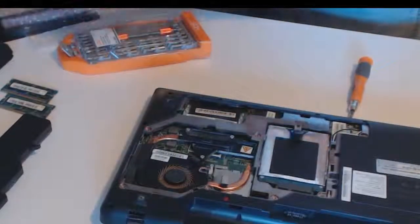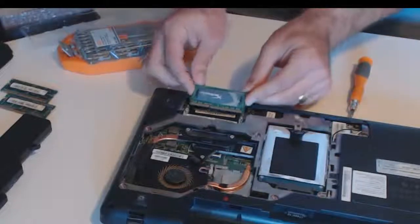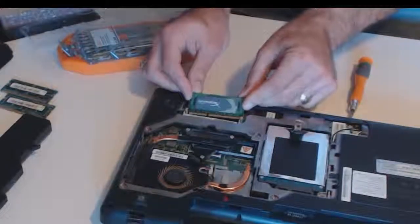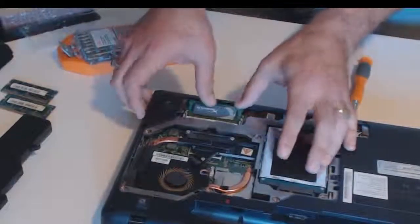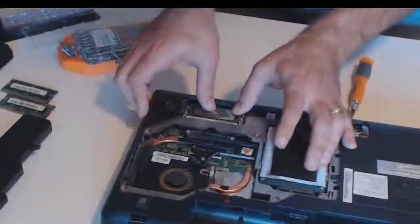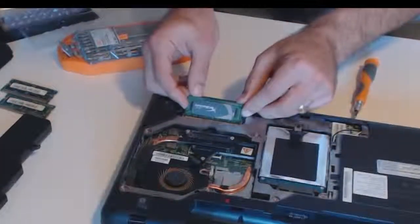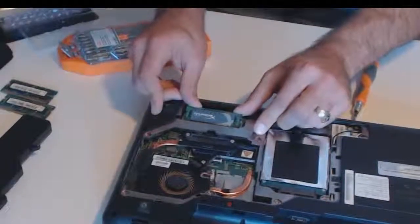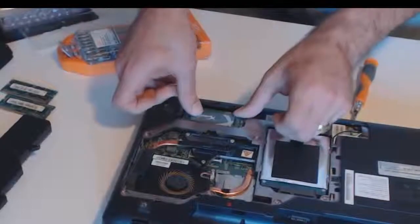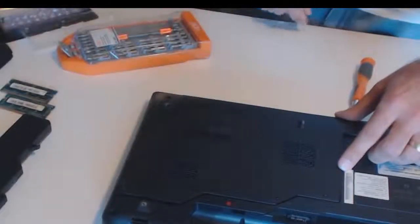Now with your brand new Kingston memory sticks, make sure that the pins line up properly. You want to set the back or bottom memory stick first. Gently put it in at around the same angle — you'll know when it goes in snugly. Slide it down and you'll hear it click into place as the pins lock. Repeat with the top stick. You don't have to push very hard; it slides in pretty easily. Just set it in, slide it to where it won't go anymore, and then set it down. It's that simple. Now you just screw your case back on, power on your laptop, and you're ready to see the RAM in your BIOS.